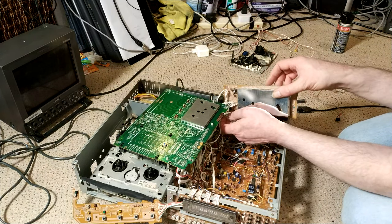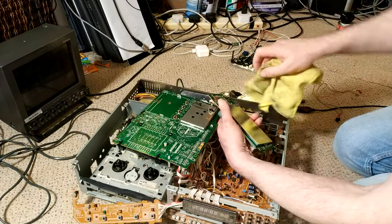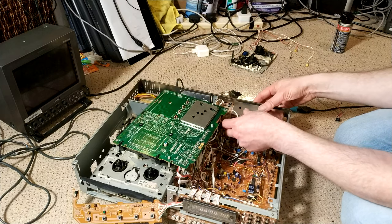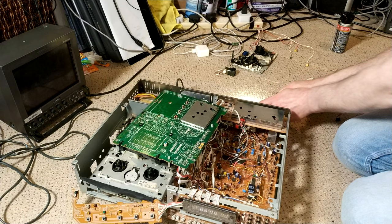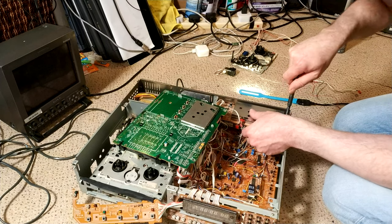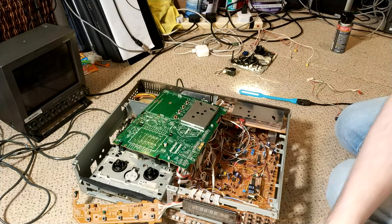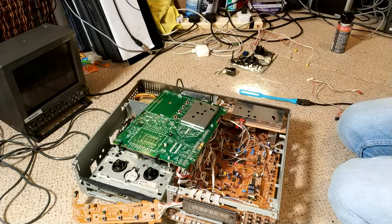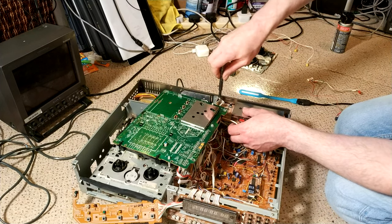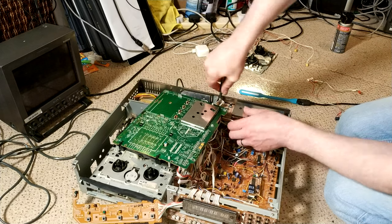That's really good — I didn't have to take this out. I will take the opportunity just to clean off the little bit of dust that's on the modulator there. It is a pretty clean machine. There must have been something wrong with this, and I'm guessing the fault was that the loading ring had snapped — in fact I know it did. The little clip that the leading guide on the loading ring clips into was broken.